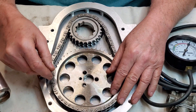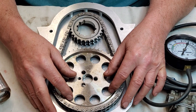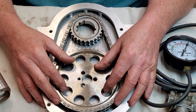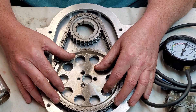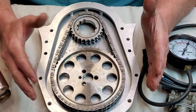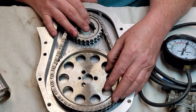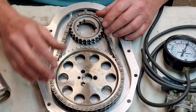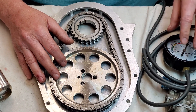If you can, run a good steel timing chain and gear when you build your motor — don't run a nylon gear. I remember talking to a Ford engineer — I said why did y'all ever put these in there? We'd replace them around a hundred thousand miles when they'd all just about jump. He said, well it's quieter. I said, can you hear that timing gear I just put in that motor? He looked at me and smiled and walked off — he knew. They do it because they know it'll wear out. These steel gears, I've seen them run half a million miles, three to four hundred thousand all the time, for people that took care of their car.